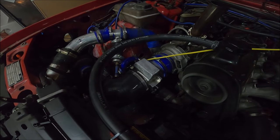One thing it also does, which is a bad thing, but I will take a lot less lag over that any day, is there's no more turbo noise, as in there's no chatter. You close the throttle and understandably that closes, so nothing comes out, so there's no chatter, there's no surge, there's no whatever you want to call it. It's just nothing. So yeah, I love a bit of chatter, but I will take no lag any day of the week over that. So, whatever.